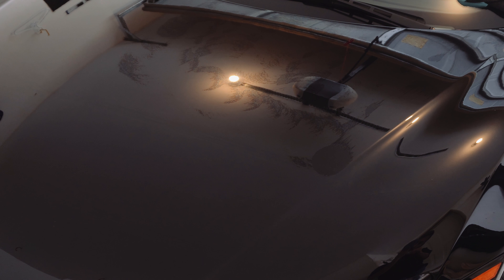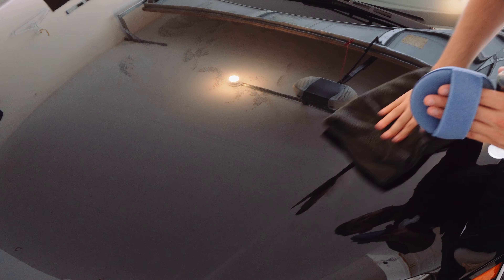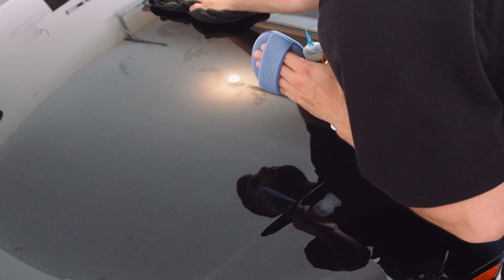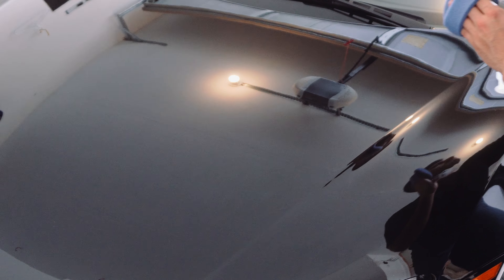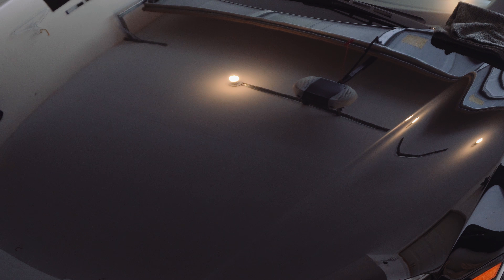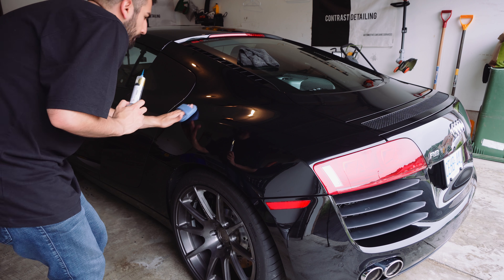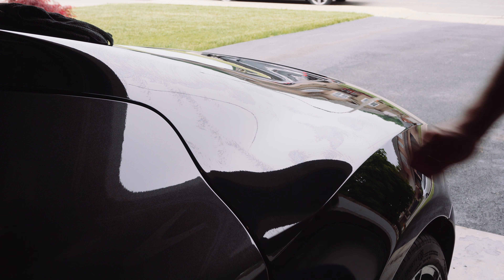What normally happens depends on the humidity and temperature. When I was applying the ceramic coating, it was about 30 degrees Celsius, so it was flashing quite quickly — about 60 seconds and I saw 80 to 90% of that oil slick look start to disappear. This is about the right time to take a very clean, low pile microfiber towel and very lightly and gently go over the high spots. The high spots are the pieces of ceramic coating that haven't flashed yet. You're just lightly buffing across the section, spreading that unflashed coating — because those sections with the oil slick look have too much ceramic coating — and that allows it to flash right away.